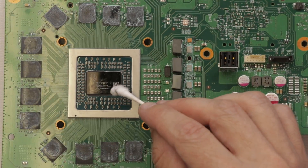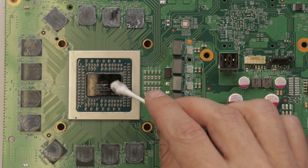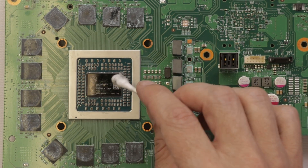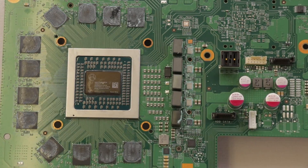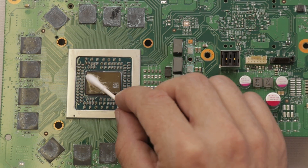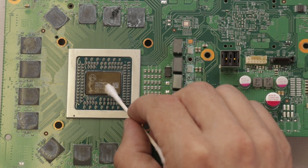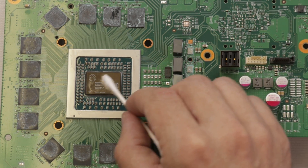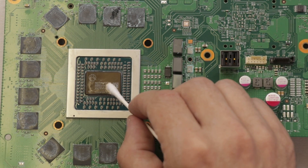This stuff in the middle is actually really hard to get off. I thought maybe it was embedded into the chip, but it actually is coming off — I've just got to scrub pretty hard. It makes me kind of nervous scrubbing that hard on the APU, but it looks like it is coming off so I think it'll be fine. Overall it came off pretty well. There's a chunk in the middle I cannot get off and there's a little bit of scuffing over here. I don't think that'll really matter — I'm going to put Arctic Silver 5 back in and it'll fill in any voids or problems that these little pieces have caused.